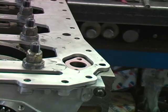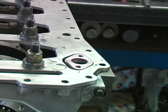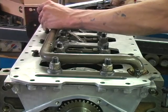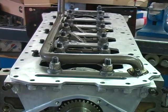Now you can install the oil pump pickup tube spacer and gaskets and oil pump pickup tube. Torque the oil pump pickup tube bolts to 18 foot-pounds. Then torque the block stiffener bolts that hold the oil pump pickup tube to 24 foot-pounds.